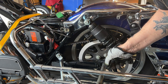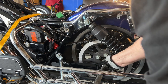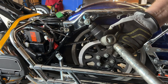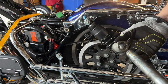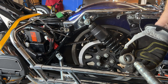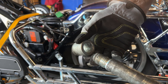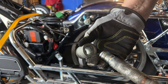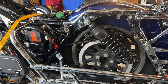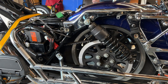You want to remember the way your spacer is in there. Here's the spacer — I'm going to clean this up and make sure it's still good. It looks like some of the teeth are gone on this. Wow, I'm glad I took it off. That could be the reason why my back wheel had a little bit of movement.